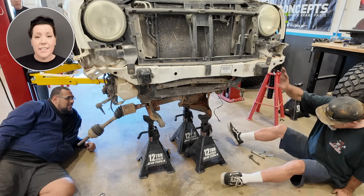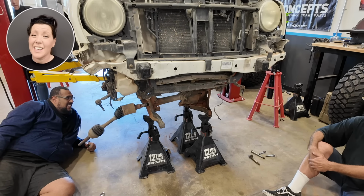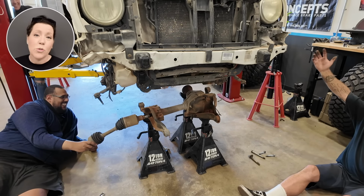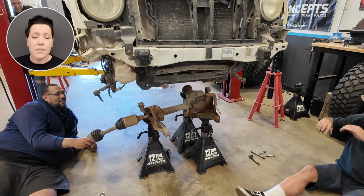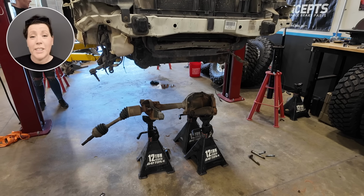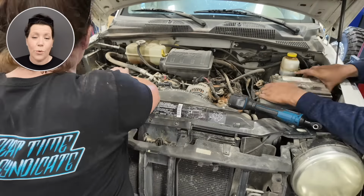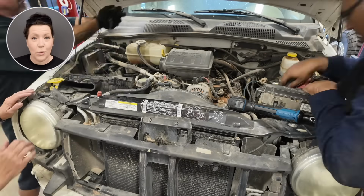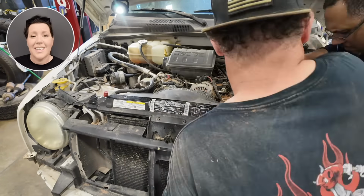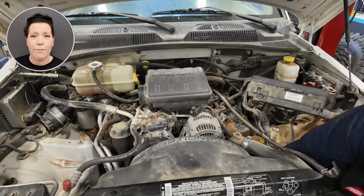I did tell you guys that I was going to explain why I'm going to be spending a couple more dollars on things that you might not want to or have to. Mine are the ball joint deletes and the knuckles. So I'm going to be switching those aluminum knuckles out to steel knuckles. I want it to be super strong. And honestly, I would have done this after the competition, so why not do it now? I'm still within the budget. And the ball joint deletes, again, just stronger. This is like a next best thing to having a kingpin, which I don't have.